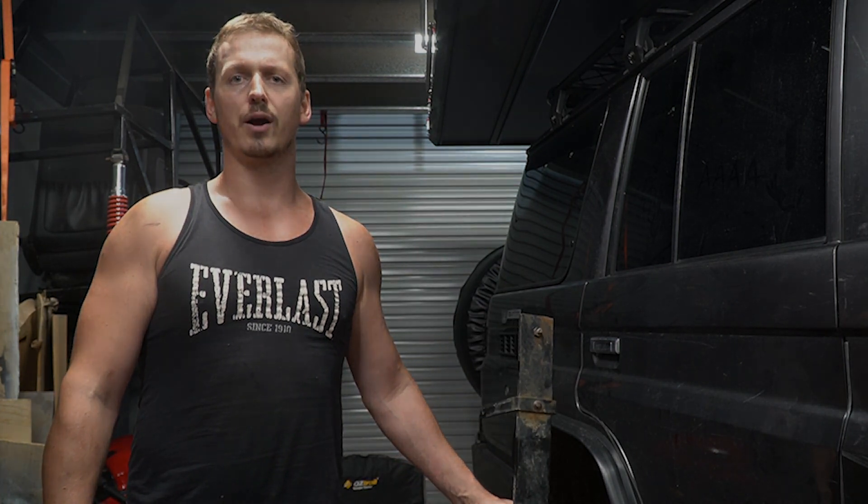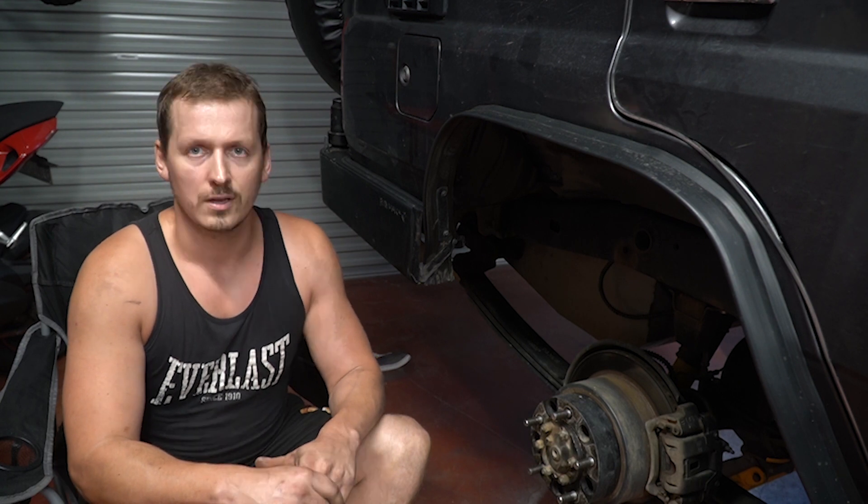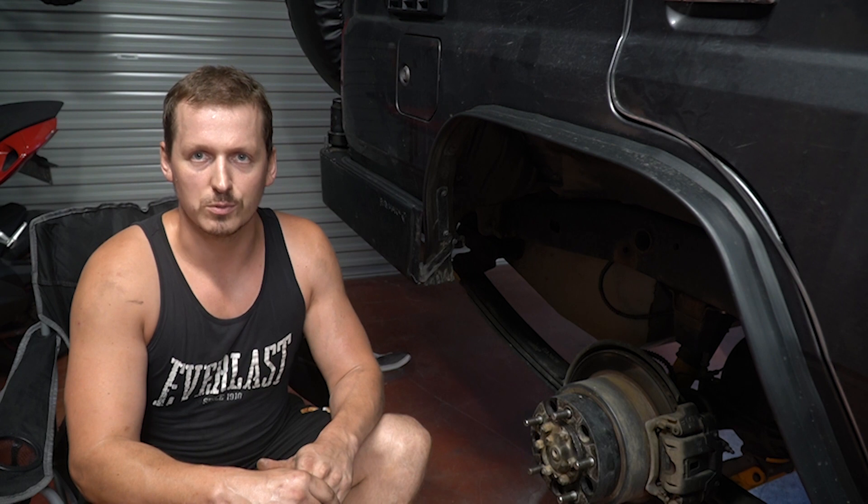In case you haven't noticed, I took mine off. The reason for this — what you might have seen in one of my other videos — is what I believe to be an engineering overcompensation. The light duty versions of these springs used to be rated from 300 to 500 kilos, and what I assume happened were a lot of complaints about sagging. So what they've done is reclassified those original springs from what I believe is 0 to 300 kilos and simply added a third spring to the leaf pack. The result is a ridiculously over-sprung leaf pack. I found that anytime I was loaded up, the lowermost spring was doing nothing, and when I needed the spring to articulate, it was restricting the whole leaf pack and not allowing my wheel to travel upwards.